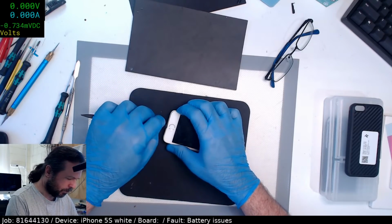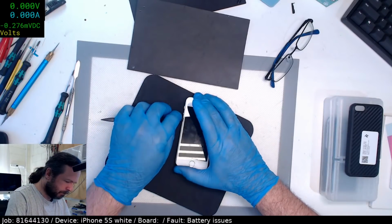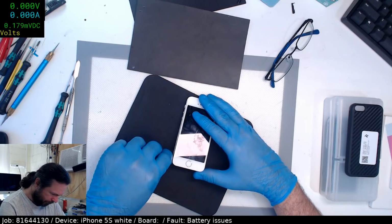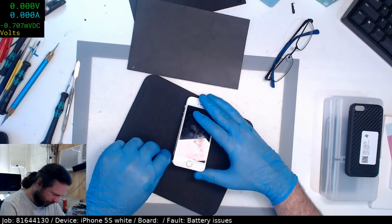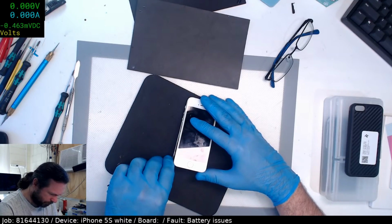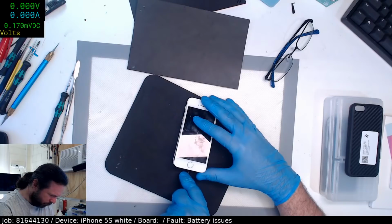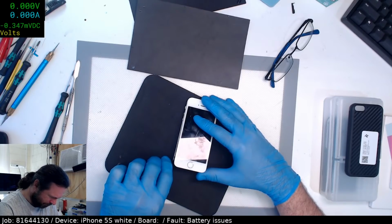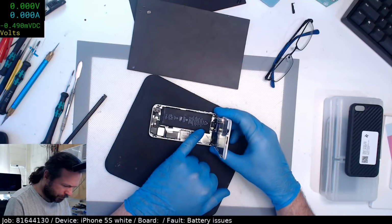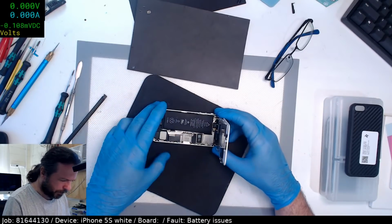Come on. This feels like it's never been opened, so that is good. Yeah, at least it's still got the retainer clip. I've started to notice that a lot of people are leaving the retainer clip out. That said, this one's been difficult to get out. This one's telling me this is why people don't put the retainer clip back in. And yeah, the battery's got little dimples and it's starting to gloss up on the edges here, meaning it is beginning to puff up.